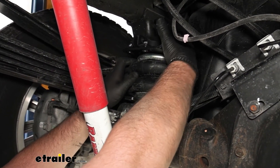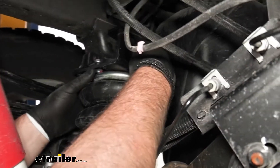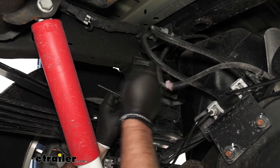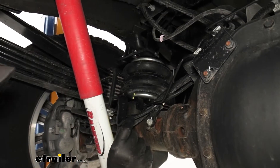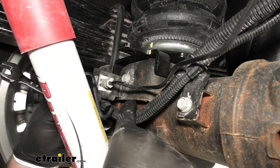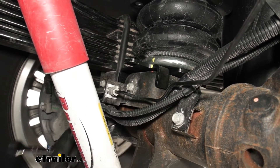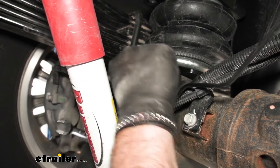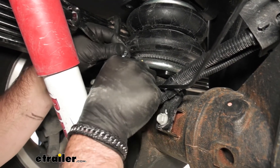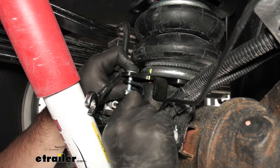Get our bag put up in place. We're going to take the large nut and star washer — star washer first and then the nut — and take a 9/16 inch wrench and tighten these down. We're going to have some hooks that hook underneath this plate and come up. We're going to have a carriage bolt that drops down from the top, then put a flange nut on it. We'll have one of these hooks for each side of the axle and two for the other side of the vehicle.